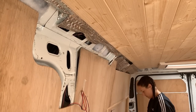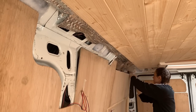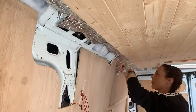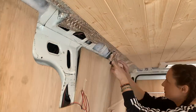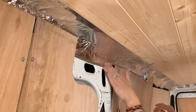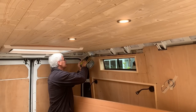To do this, firstly I had to sort out the vapour barrier. I decided not to vapour barrier the whole van because research showed the results were negligible. But I did think it would be a good idea to do the roof because with all the cooking, all the steam would rise. Here I'm just taping it down to the side of the van making sure no air can get through. While I was doing that, Dad was working on the other side getting it prepped for the cladding.